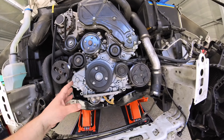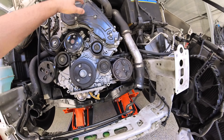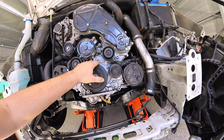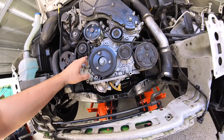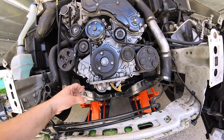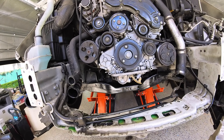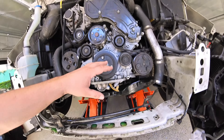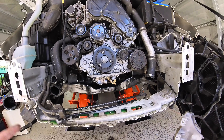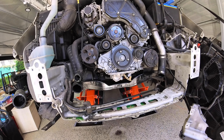So, first things first: take off the serpentine belt, take off some pulleys, take off this cover here, take off the timing chain, and then move down to this cover here. Hopefully I can take this off and leave the other one on. I've just got to get this off and then I can get this oil pump out. Hopefully in a week or two the new one will be here, I put that back in, put everything back on, start it up, cross my fingers and hope for the best that we've got a properly sounding engine. That's where we're at.